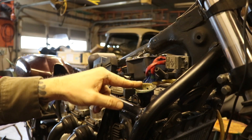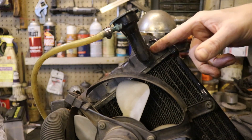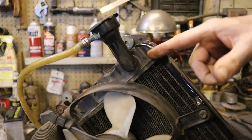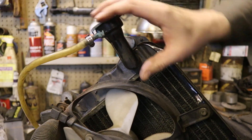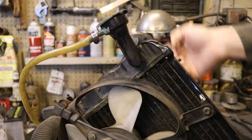The simplest way I can think to do that is to get in here to the weld where this is soldered together, because this is all brass. So that should be soldered in right here, and I'll heat this up so I can rotate it — just rotate this whole thing over just a little bit — and then re-solder it.